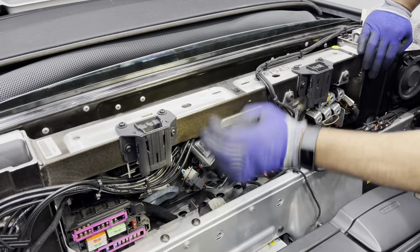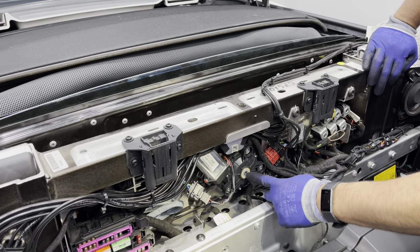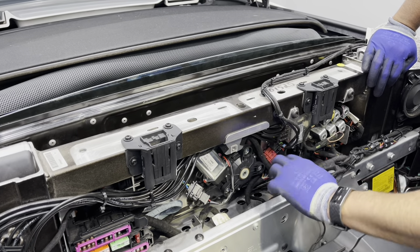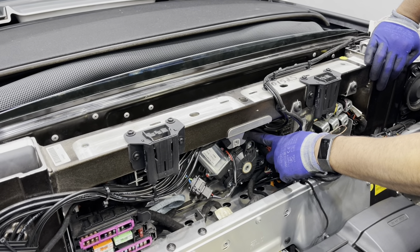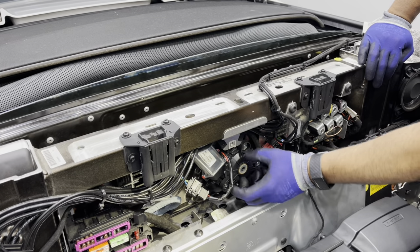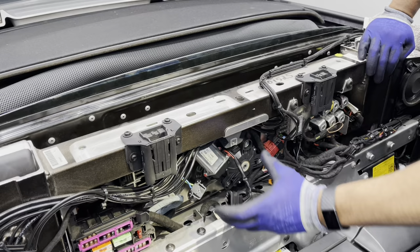In the middle we've got the motor for the rear window. It's held on by three bolts — one, two, and three — and you've got the manual override here with a square drive in the middle. When you remove these bolts be careful because you've got some aluminium spacers at the back — three of them — so make sure you catch them. Take the three bolts out, unplug the plug, and just wiggle the motor and take it out.